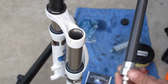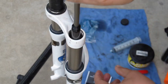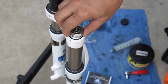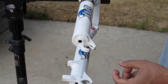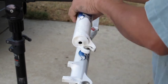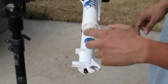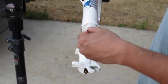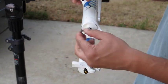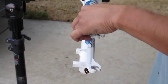Now insert the dampener but don't screw it in yet — you want the dampener rod to come through the bottom of the fork. Once the rod is fed through the lowers, put the foot nut on. Make sure you put the crush washer on first, then the foot nut, and tighten it down to spec.